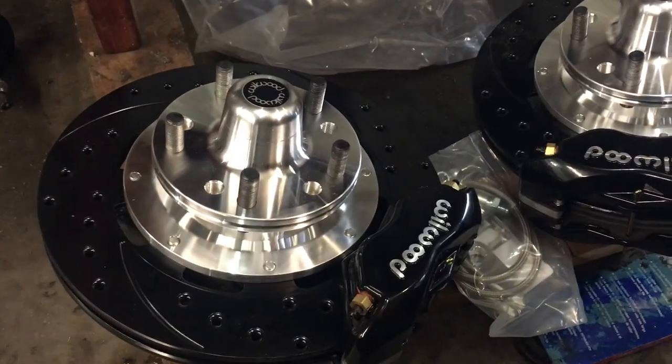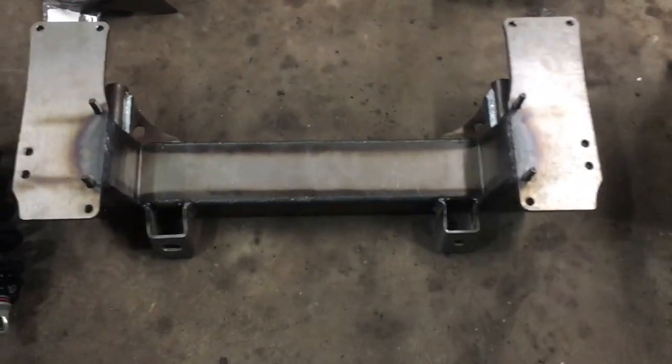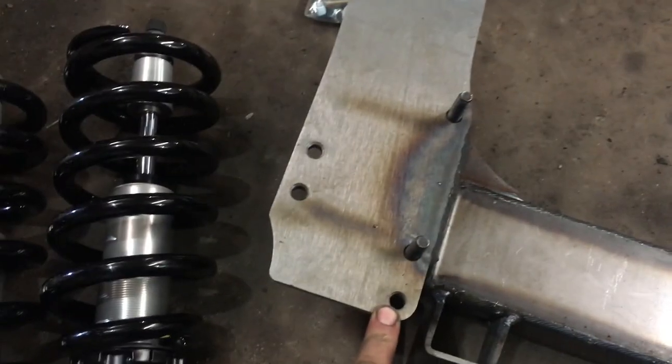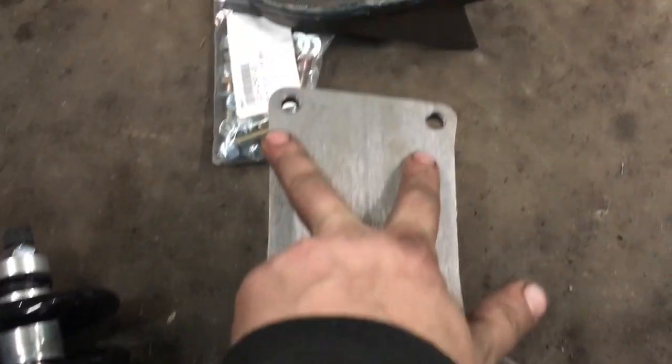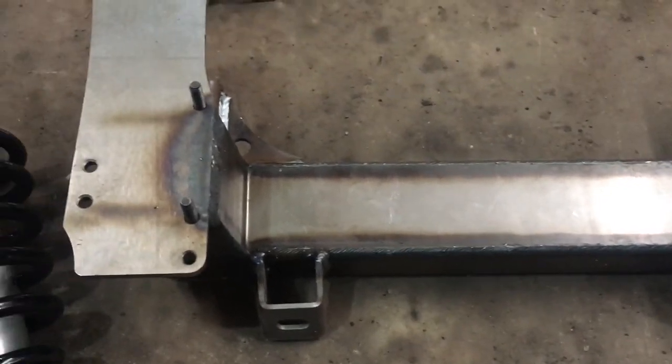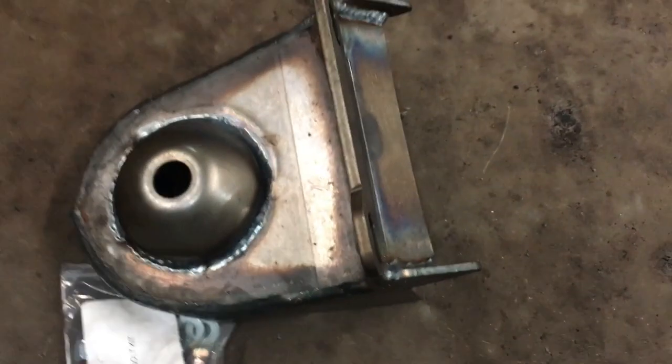I'm really looking forward to getting this thing in here. Let's go over the main part of this entire setup. The crossmember itself has two studs on each side that line up with some existing holes in your frame, so you don't have to do any real measurements to install it correctly. Two holes on each side you'll have to drill yourself — a total of four holes to drill — then you can bolt it right in. The manual says to torque them to 45 foot-pounds. And then you have your shock towers, which have to be welded to your frame rails.